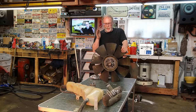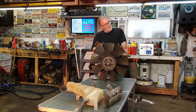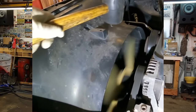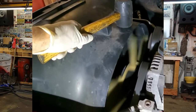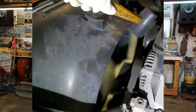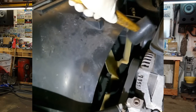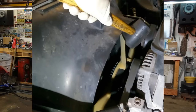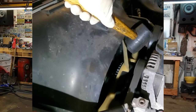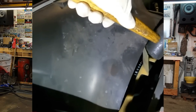If you're having a hard time determining if your clutch fan did go out on you, basically, and this is dangerous and only for the people who have automobile experience, but this is what we do in the shops, believe it or not. We'll turn the engine on and we'll have one guy inside who will then turn it off, and with a leather welding glove we'll just kind of press against it. If we can immediately stop it, then we know it's shot. It's just a quick way of doing it. Maybe not professional, but that is the way we do it in the shops.